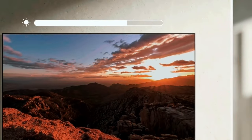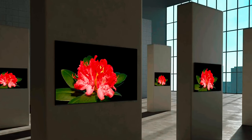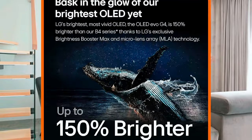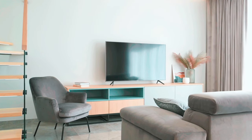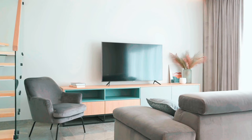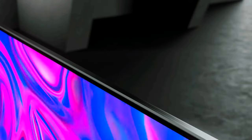Some experts tested the TVs using a Klein K10A colorimeter, a Murideo 6G signal generator, and Portrait Display's Calman software. Samsung's S95D wowed them with the brightest picture they had seen in an OLED TV by far, but the G4 is neck-and-neck on that front. Out of the box with an HDR signal in HDR Cinema mode, the G4 shows a peak brightness of 243 nits with a full-screen white field, 1,103 nits with an 18% white field, and a blazing 1,510 nits with a 10% white field — in line with the S95D at 321 nits full-screen, 1,060 nits at 18%, and 1,613 nits at 10%. The mini-LED Hisense U8N blows them both out of the water with more than double the peak brightness at 2,155 nits for an 18% field, but its trade-off is light bloom and blacks that aren't as inky or detailed.